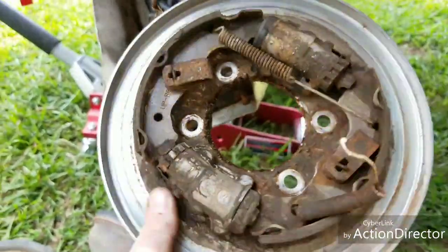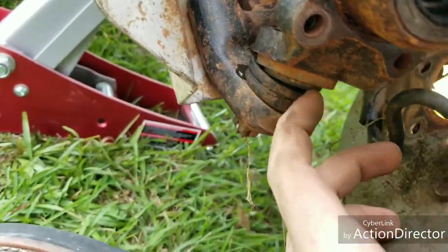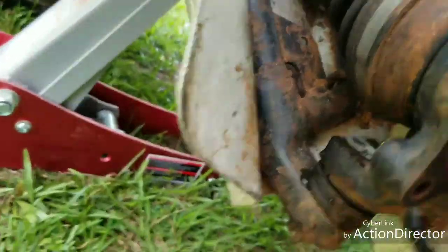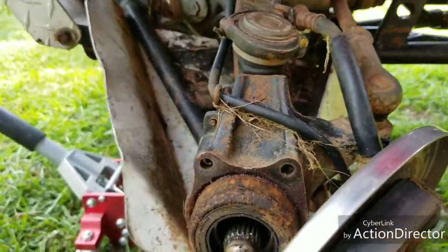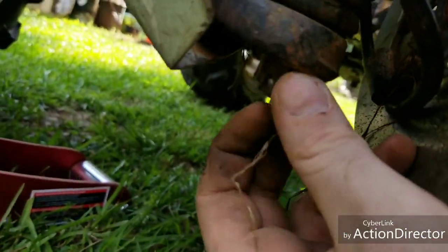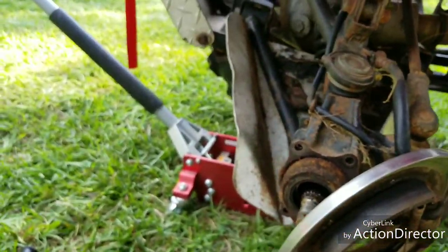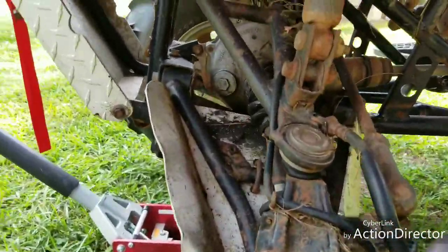Now that we've gotten these drum brakes out of the way, I'll get to the next step: taking off the ball joints. I think you can get the axles out without doing it - I'm not 100% sure - but I have to take them out anyway, so I'm going to go ahead and beat the ball joints out. You have to take the cotter pin out just like the other ones.